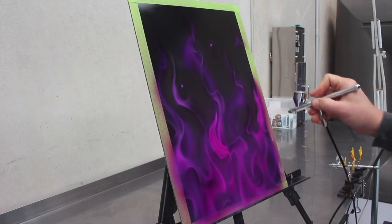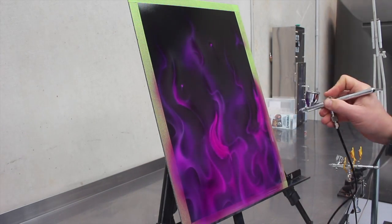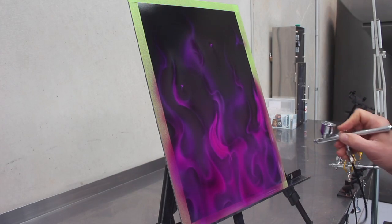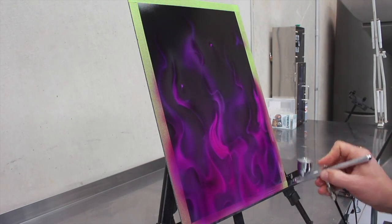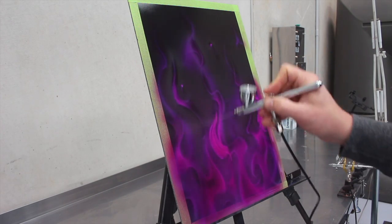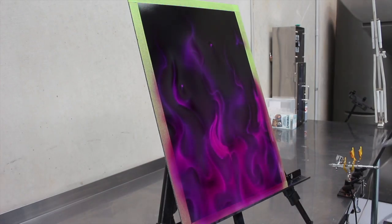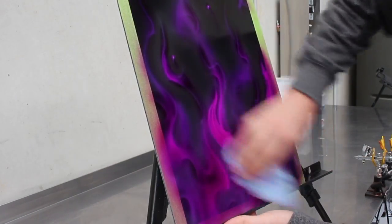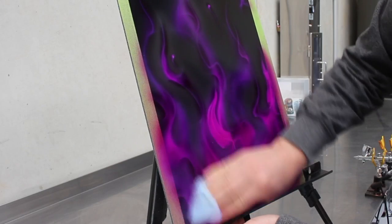Some candies, we also use a lot of House of Colour candy, and those basically you can get as dyes. Same with DNA, you can also purchase the dyes. If you do purchase it as a dye, the benefit is you can control the strength of it, so you can mix it up and make it a bit stronger so you do less coats. But you've got to then mix it into a carrier, so just be wary of that. And when I say carrier, I mean a binder, so it's just a transparent base coat.